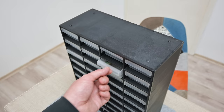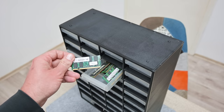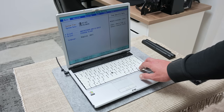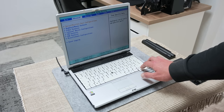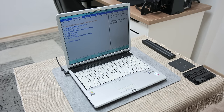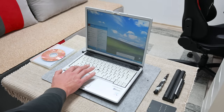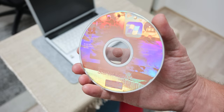Anyway, I only had some parts for these older laptops. So first I took some RAM and an Asus power adapter. The Asus power adapter is the same as the Fujitsu Siemens adapter — the connector, voltages, and everything match. And to my surprise, this machine turned on, which I really didn't expect. I did some tests to check the laptop and then put in a disk I use for testing and installed the legendary Windows XP.